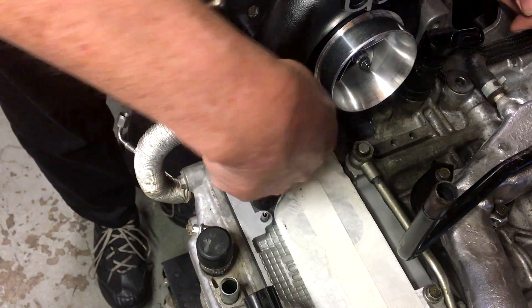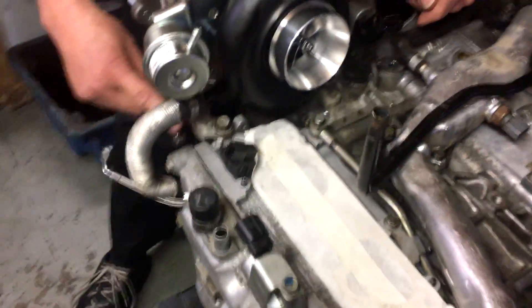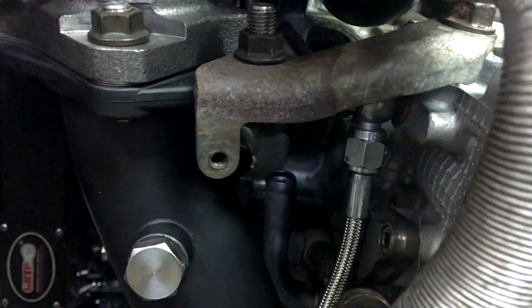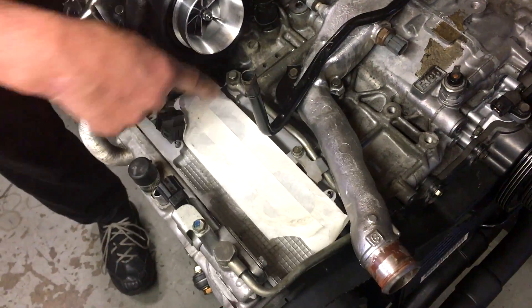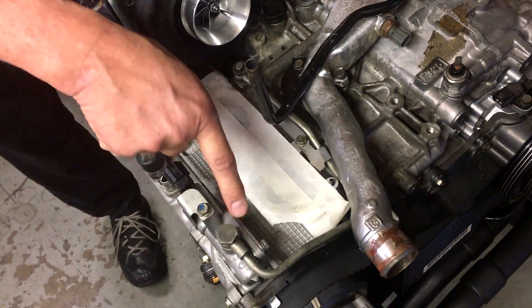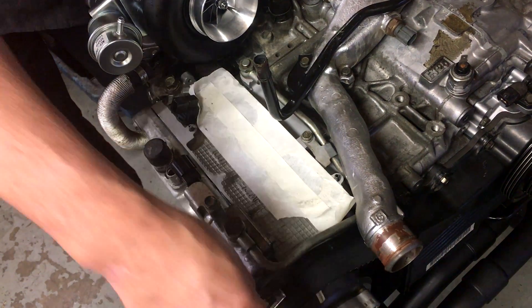But on this particular engine, when you get a bigger turbo, there's not enough mechanical room to get the hard line hose. So on this particular model head, there's actually another port on the back of the head that you can use for oil supply, which is what we're using — and which is why it's still loose — to connect to the turbo and then use a different model oil line out of the side of the head to supply the variable cam control.